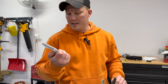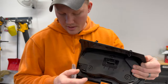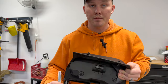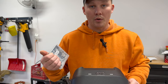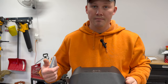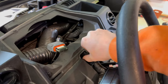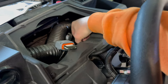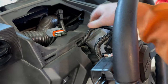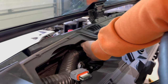So I got the wrong size here. When you pull the instrument panel off, you're going to see right here where it actually goes in, and you're going to need to buy these adapter pin pieces to go onto the wire to hook into the plug in there. I'm going to have to order the correct ones — the ones I have aren't going to work. So we'll wire everything else up, get those pieces in, and then fix that. We're going to run the indicator switches, the turn signal switches, horn — all that in. We're going to run that right through that hole and then through the dash to the other side to hook up.